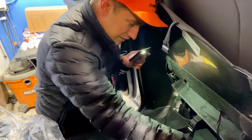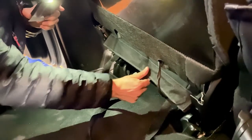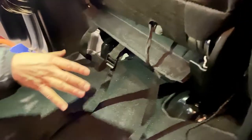And there's also this Velcro right here that's going to attach onto the side of the seat. I'm just going to push that around and then it's going to attach on right there. Now that this is pushed through back here, you're going to want to pull on that. Make sure it's pulled through nice and tight, and then go around, check the front, make sure you haven't pulled it too far back. But you're going to get that lined up so it's nice and snug. And now there's three straps back here. Two outside straps that are going to go forward underneath to buckles, and then cinch on.